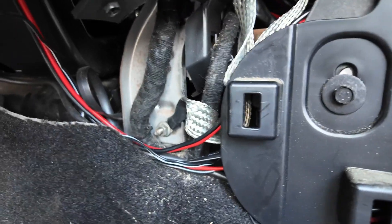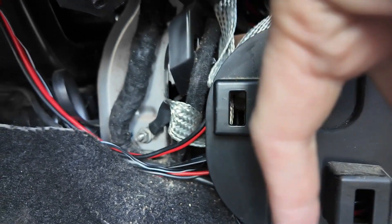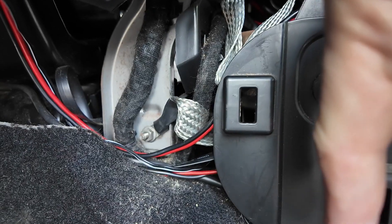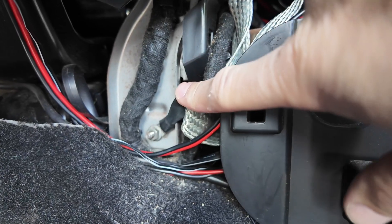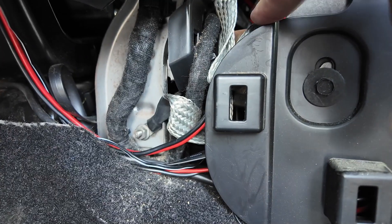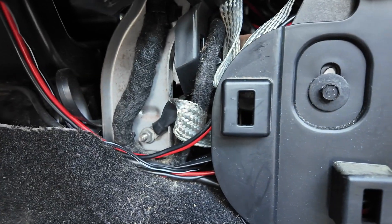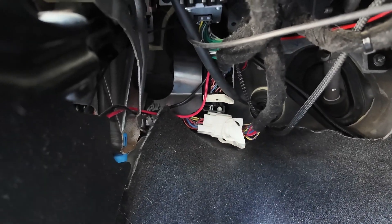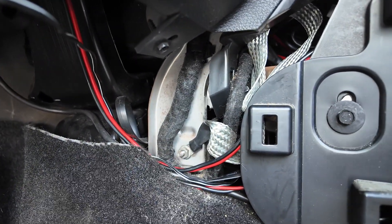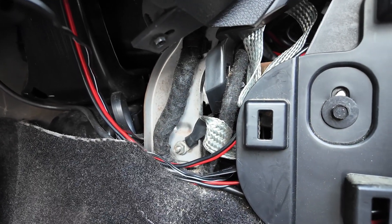This is the last grounding point. I've confirmed this is actually mounted or screwed into the frame itself. Is it the most optimum location for grounding? I don't know — time will tell. But I noticed that the back of the radio and this grounding point look good continuity-wise. There are a number of other locations underneath here that I could probably mount to if I need to get a better ground down the road, but I think that mounting bracket which supports the rest of the console and all of the other stuff should suffice.